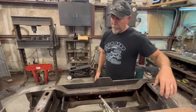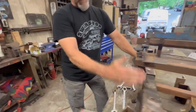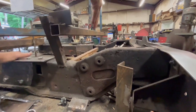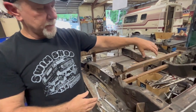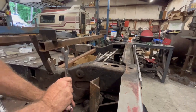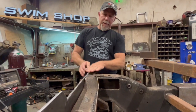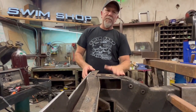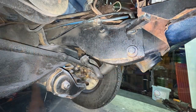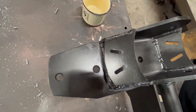Not only that, but on this side — this is actually the driver's side — this is where the steering box mounts. It mounts straight up and down, and with the pitman arm going this way, it lines up perfectly with the way we do the crossover steering. But the steering box on the older ones is mounted at an angle instead of straight up and down. That completely changes the way the steering is done, which isn't a problem — we could work it out. Also, on this side, this is flat, but the older vans don't have a flat place on this side. When we make the kit, we've got a front plate and we utilize those factory holes to bolt it. So we couldn't do that on this jig for the older models.